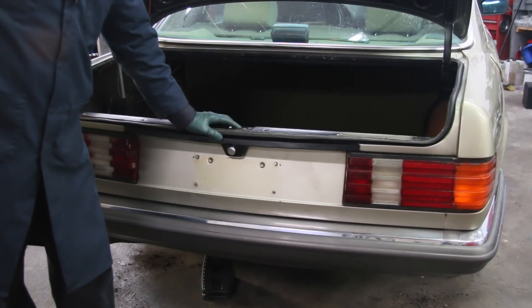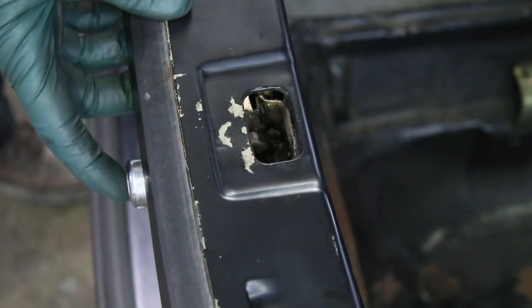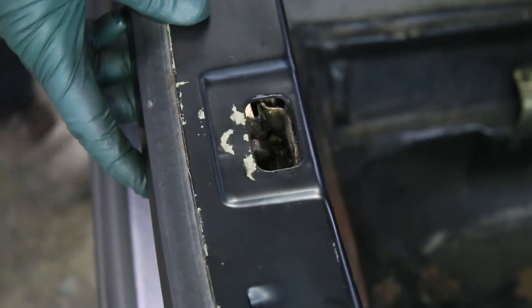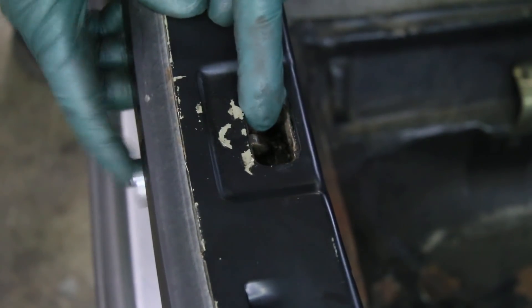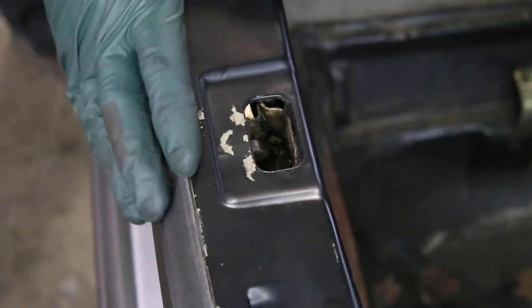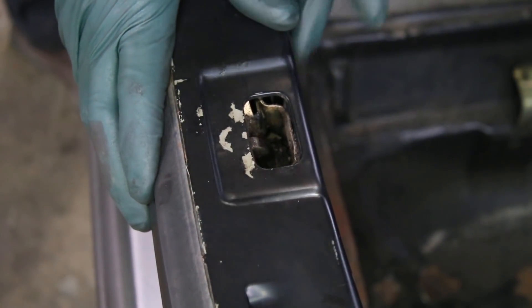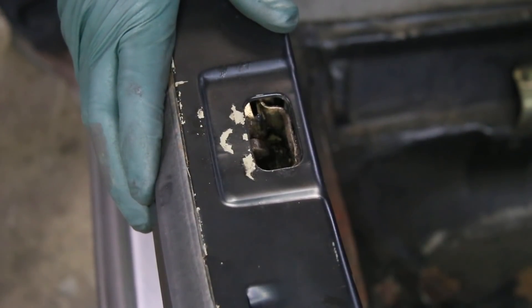Let's take a closer look at this mechanism. Notice when I push the button for the trunk release that this little latch is not moving. That little latch should come back to release the trunk lid. What that means is the vacuum actuator that controls your trunk locks is not releasing, and it probably means your vacuum door locks are not working properly or working intermittently.